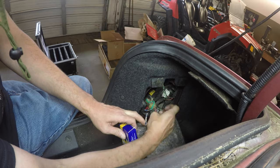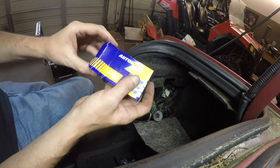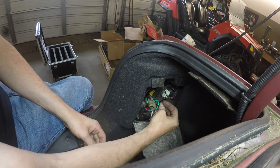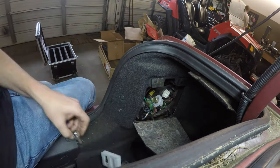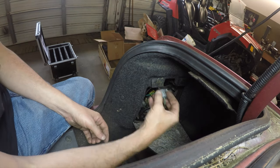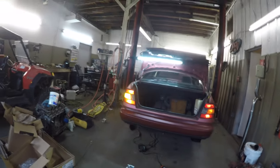8 of them. But now there's newer, more efficient technology available that plugs right in as a direct replacement for those 1156 and 1157 bulbs. So I might as well give her an upgrade. LEDs are more efficient, and this makes them brighter while consuming less current. But older car circuits are designed around the inefficiencies of the older incandescent bulb. Incandescent bulbs also don't care which way the current flows through them like LEDs do, so even though they plug right in and fit the sockets, you need to ensure that they function the way they're supposed to on your car.